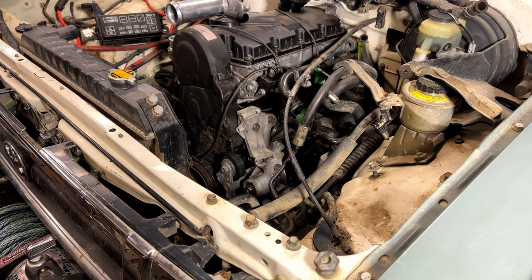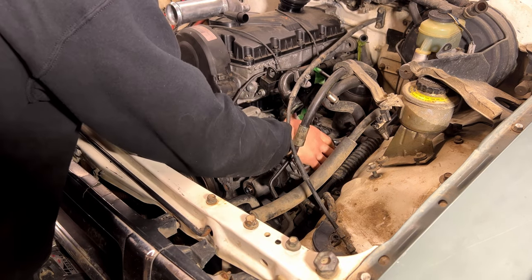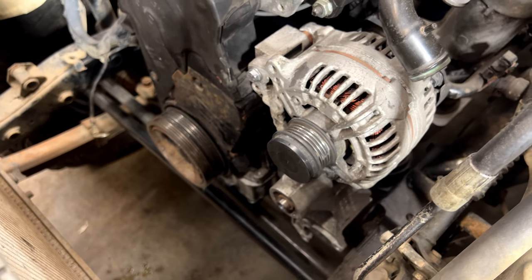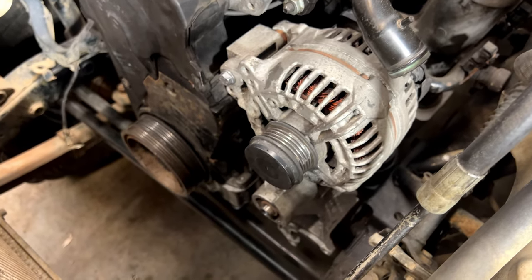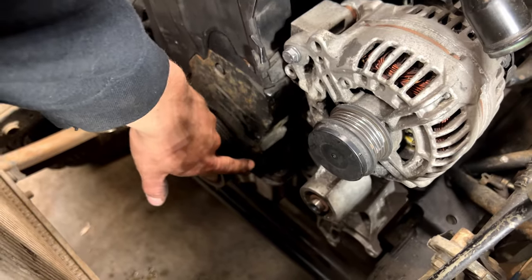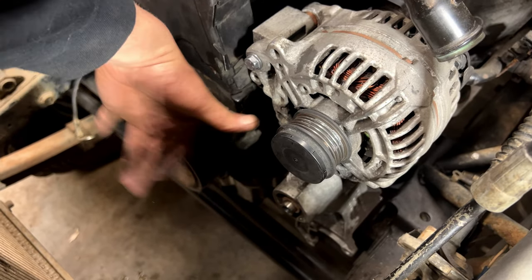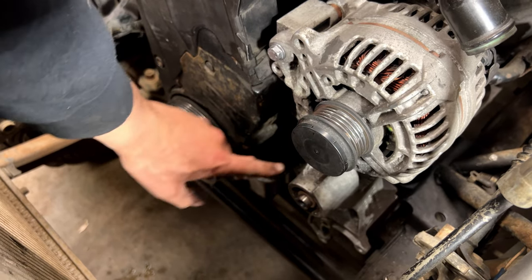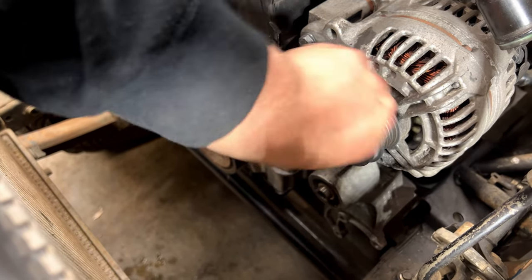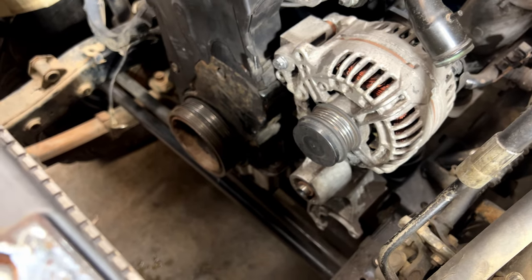Time to throw this alternator back on. I'll probably have to take some of this stuff off later, but I just want to get it bolted up so I can see if I need to move anything else. I think I've got the alternator figured out — bolted back up how it was in the car, but I removed the idler with the fan hub and the tensioner. I'm going to run a stretch belt — it's a type of serpentine belt that's slightly shorter than the distance around the two pulleys. You put it on half over either the crank pulley or the alternator and roll it over, stretching it onto the pulleys. They work really well — I've seen them a lot on heavy machinery.